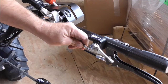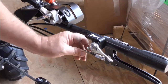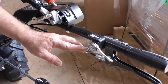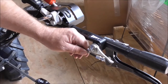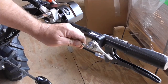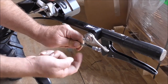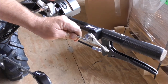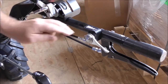Your throttle cable fits inside this little metal cylinder that fits inside the throttle lever. If that comes out, it's not a big deal — grab the sheath of the cable and pull it. Bring that cylinder piece back, bring your cable itself; there's an opening all the way up underneath here that allows the throttle cable to sit into. Pull the sheath back, reposition the throttle cable in that little groove, then put it back in position. Now it's in position.